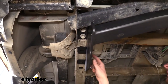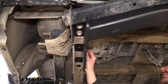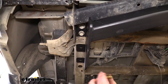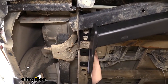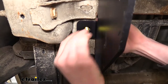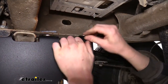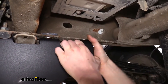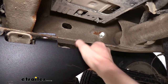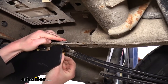With the factory hardware installed, we come to the holes towards the front of the vehicle. We'll need to place a flat washer between the hitch and the frame — that's why we left the factory hardware loose, so we could slide that in. Then we'll take the spacers that come in our kit, slide the carriage bolt through, and drop it down through the top of the frame, through our washer, and then through the hitch. We'll secure it with a flange nut on the other side. Do the same with the other front hole, pushing up on the hitch towards the back if needed to get everything to line up, then do the same over on the other side.